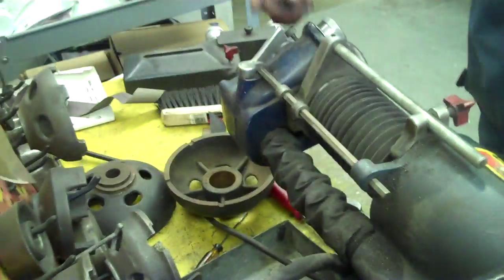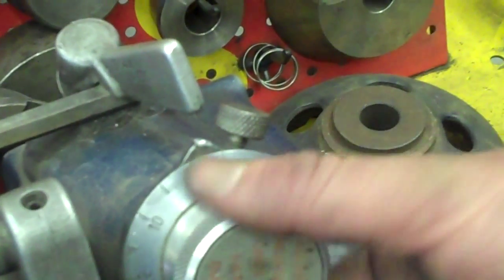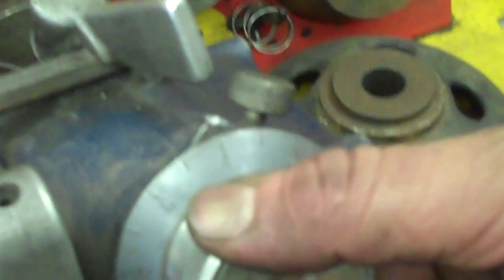Let's go ahead and tell it to hit right here. Here's our notch — we're going to go four notches. Snug this last one down right here and we're ready. That setting is for rotors; this is for drums — so do not go to that side. While the machine's running, you can adjust your speed. Sixteen is way too fast, so we're going to go to four. Four is the perfect speed. Then just engage it and we're done.